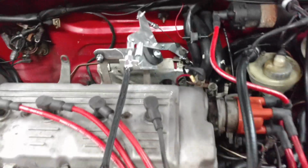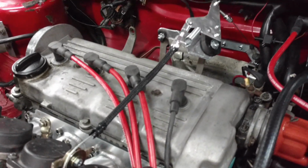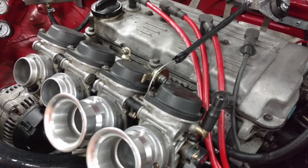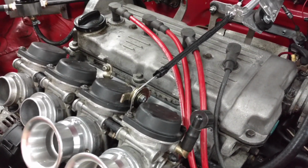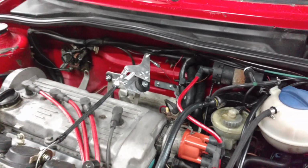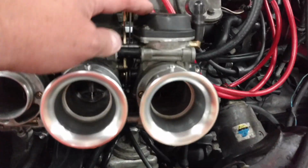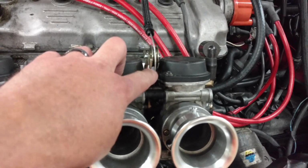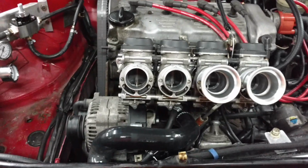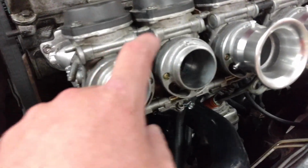Get in there and operate that, would you, for video, Jim, please? I needed to reduce the travel. Yeah. Being that it's a motorcycle car. So there you go. Is that full? To the floor, full throttle. Yep, full throttle. Good. So we think that that's going to fix the throttle. Last night when we were test driving it, the throttle cable kept coming off. So we needed to revisit that, I guess. And he's going to be putting these horns back on.